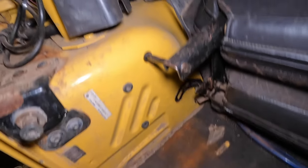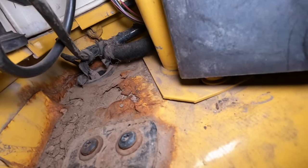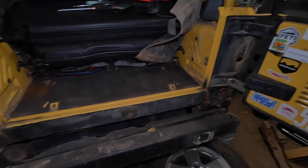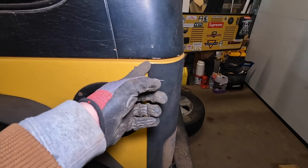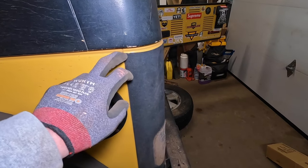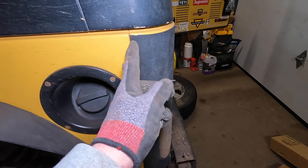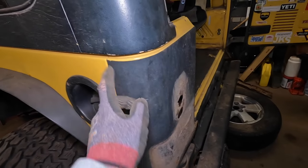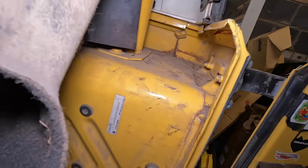This side isn't terrible either — there is a bit of rust up here we'll address. Once we remove the corner we'll be able to get in there better, maybe throw some fiberglass down. Next I need to take the tailgate off. A subscriber told me to use an air hammer in there because those aren't seam sealer — they're spot welded on the inside. We'll use an air hammer but first we're going to cut just a little bit away from the seam so we can see what we're dealing with and not lose the lip.